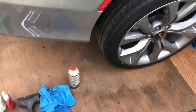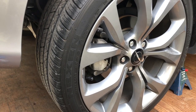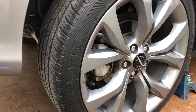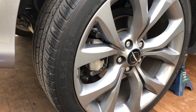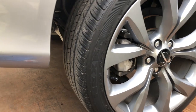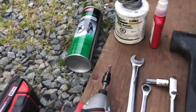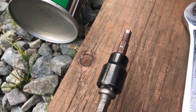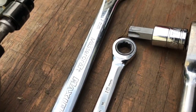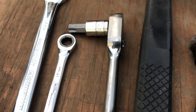Now moving on to the back end of the car — we have a little bit of a different procedure. But going into the settings menu at the start of the job is going to save you a ton of time. Other people have made videos and they struggle with these rear brakes, but by simply going in there and retracting the park brake you save a bunch of headache. For the back you'll need: the number 5 hex again for the rotor set screw, a 17mm wrench, a 10mm ratchet wrench, and a T55 Torx as well.